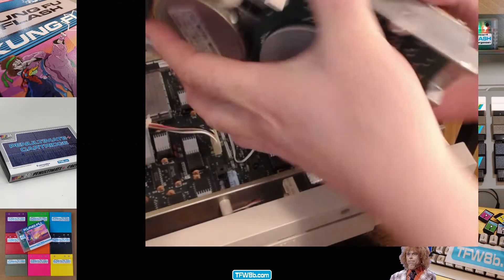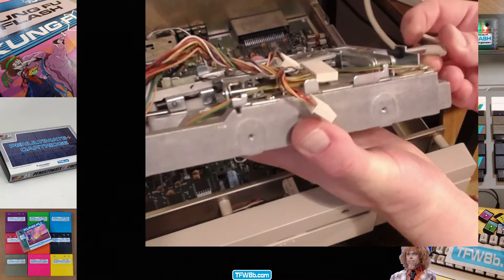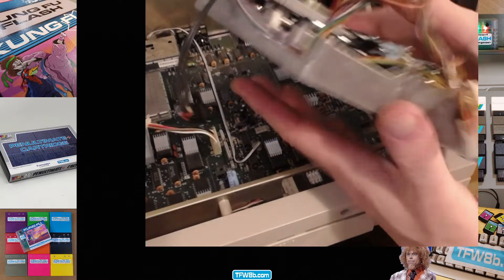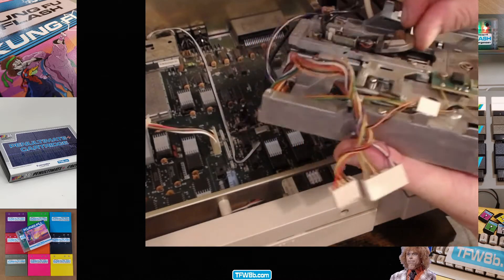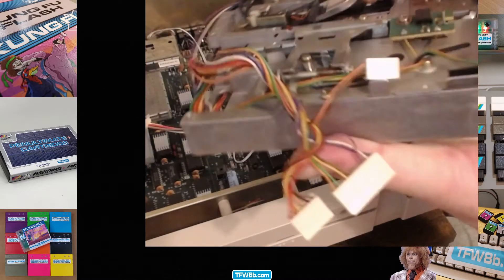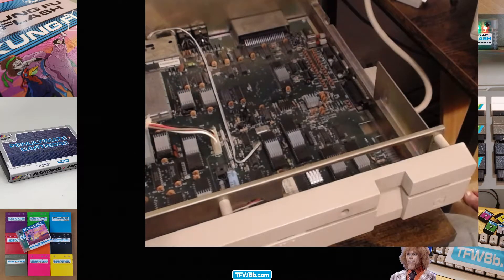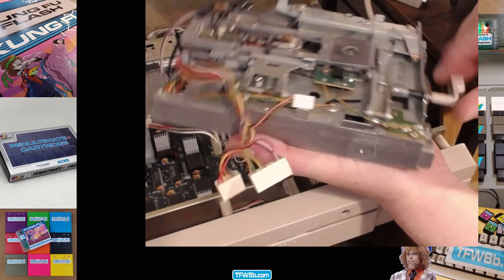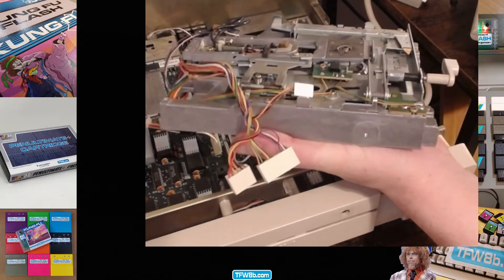It's Billy Jump Cut! Just proof taking the drive out. That sounds fine. Where's the locking mechanism? It's great that you don't have to use a screw to fit these - there was a drive back in the day where that required a screw and it used to annoy me. But yeah, that's spinning, so the noise isn't that. I think the noise really is, literally, just probably the state of these heads - covered in... yeah, it really does look filthy in there. I think I'm just going to give this a quick clean up, a bit of dry lubricant, which is good stuff to have. Find another disc, put it back in, and then get on with the next bit. That's the plan.